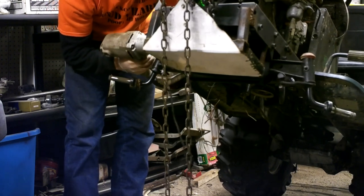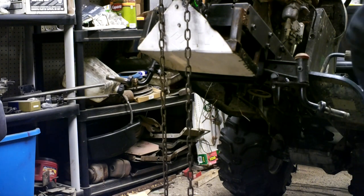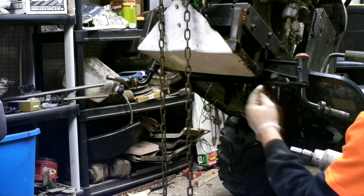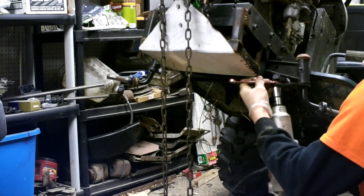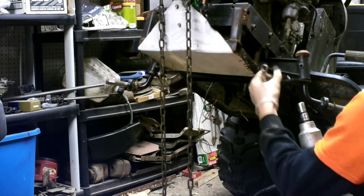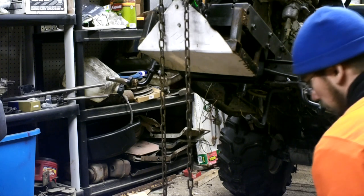Just make sure you pay attention because the upright trigger on some electric impacts is reversed, so always check it. Your ball joint is going to be a 9/16ths on the bottom, but on the inside of the ball joint there's a nut — you're going to put a half inch on that. Then just pull it up out. On the top is going to be a lock washer, so hold on to that for reassembly.